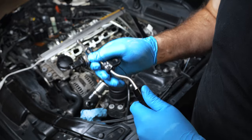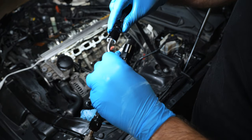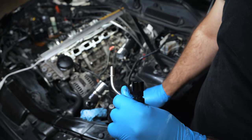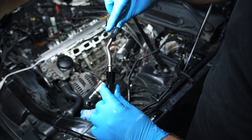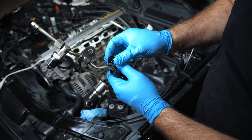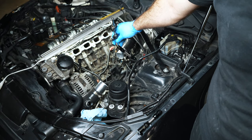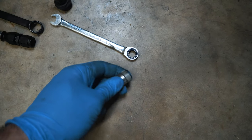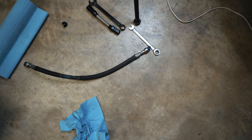I'm removing the filter out of the HPFP. I'm installing the low pressure filter, so we've got to remove this line — that means jacking up the car and looking from underneath for where the other end of that line is to insert the filter. Here's the low pressure line. You may have to bend this to clear the starter. Normally you have a connection that goes like this, the plastic retainer snaps in and locks in, and then you push the plastic retainer to remove the line. I went underneath — it's very tight down there.